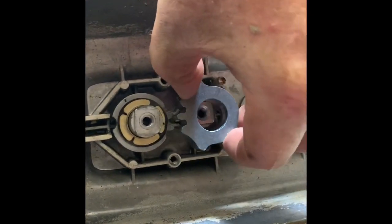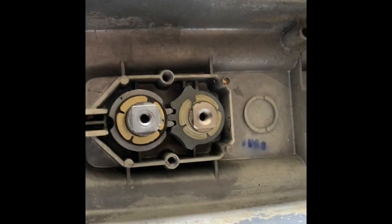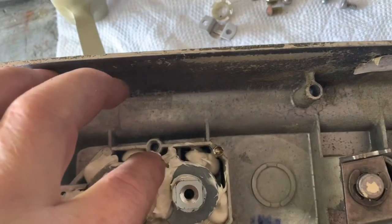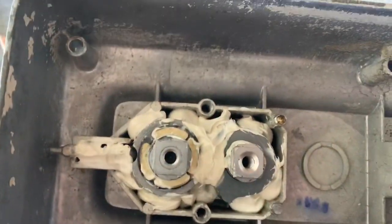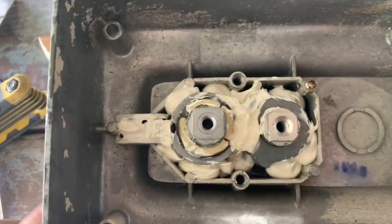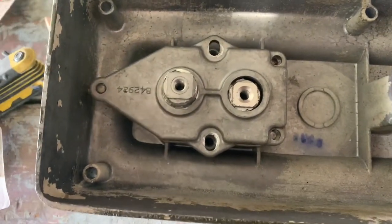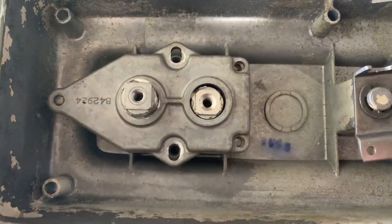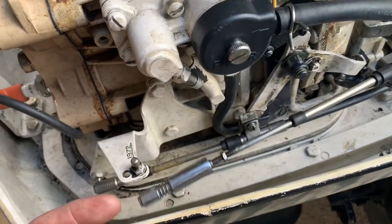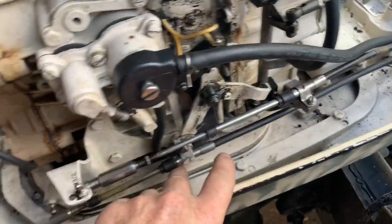The gear just drops here onto the other gear where they meet up, and this goes over that. I've got the detent springs back in with the balls — I had to use a screwdriver to wedge them up, unspring them, stick in the balls, and reinsert them. Everything's in place; just got to get the cap on and then put the levers on for the shifter cable controls. To remove the cables you just push back and pull up, and that frees it up.